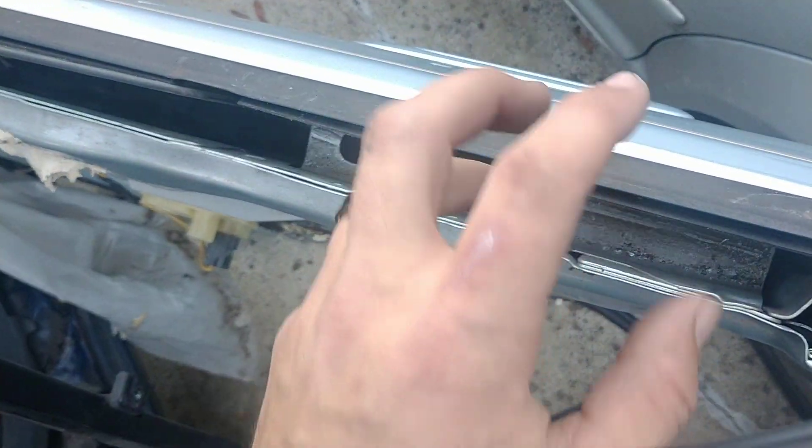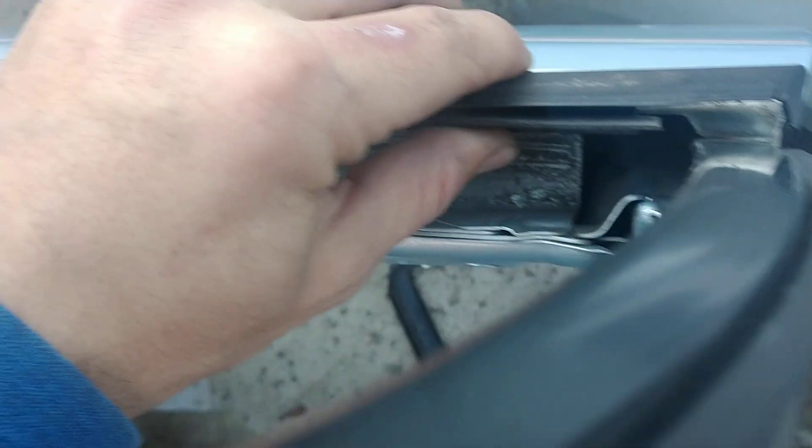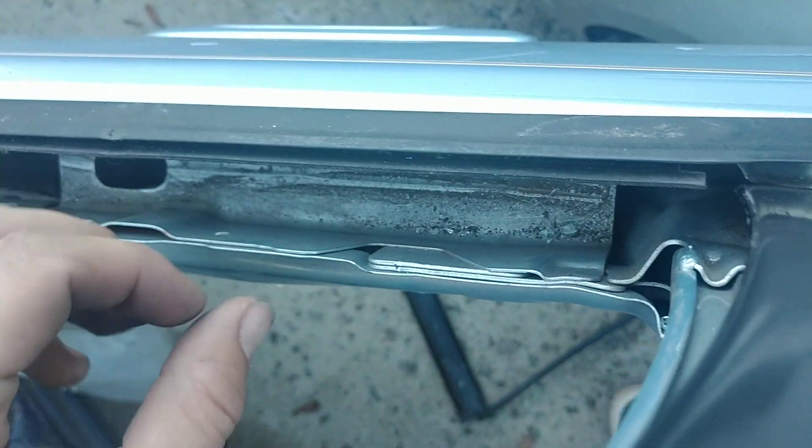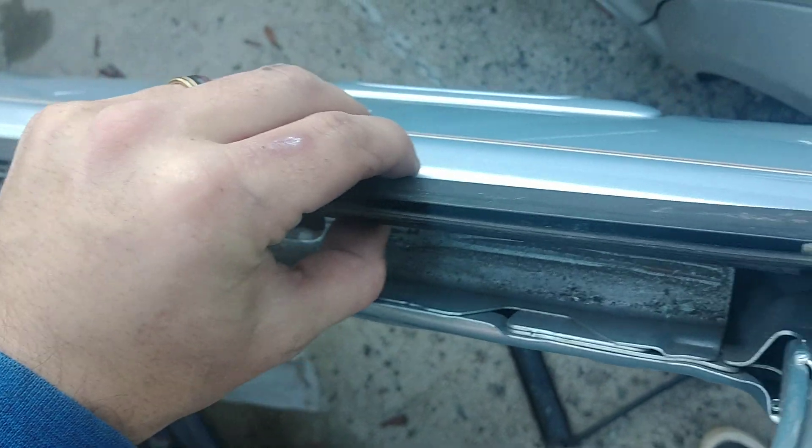Once that's out, the trim piece for the window will just come right out. There's no glue and no sealant on these quarter windows that are indoors — they just set right in with a rubber seal. That piece will just come right out from under this little trim piece; just lift it up and it comes right out. No need to pull the entire trim piece — you should be able to get it back in with just lifting one of the tabs, because there are little clips right there that hold it in.